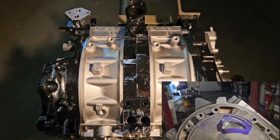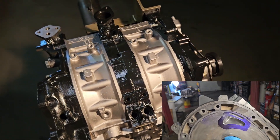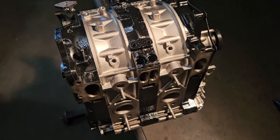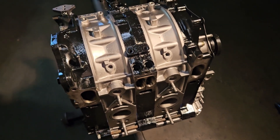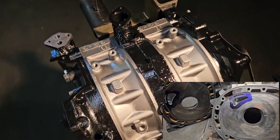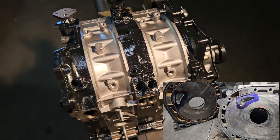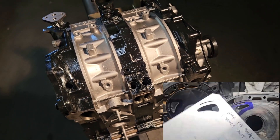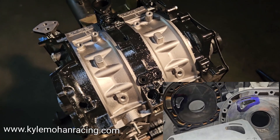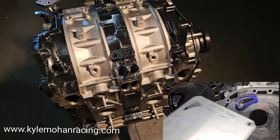I think it's a cool build for full bridge port turbocharged motors. Obviously you're giving up some bottom end in favor of the top end, but they sound amazing and make lots of power. I always think of a full bridge port or a semi-peripheral — anything like that — in relationship to a piston motor as a very aggressive cam. That's why you're getting that brap due to overlap of intake, exhaust, and port timing.